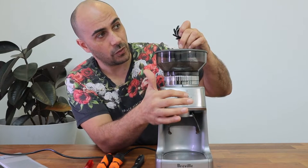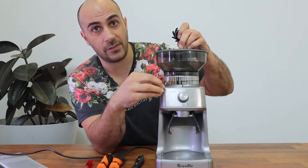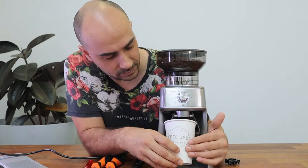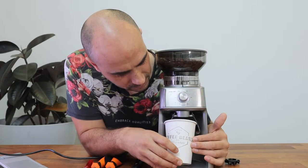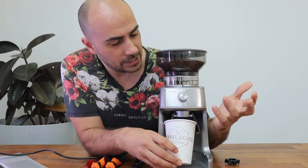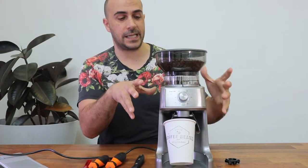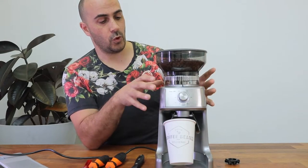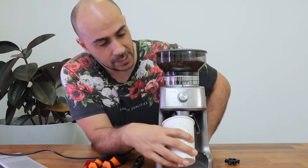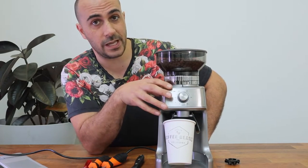Let's have a look at what the issue is and then we can see if this is the impeller sound that you're experiencing at home and you can fix it yourself. You can hear it's really struggling — there, see how it turns on for a little bit, grinds a bit, then the light flashes on. That is what normally indicates the impeller blade is worn out. Sometimes it makes a clack clack clacking sound and that can also be an indicator.